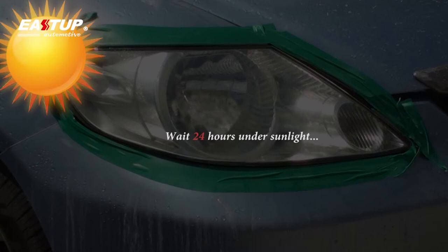If there are UV coating runs or spots, continue with the next steps. In order to achieve a smooth, even lens surface free of drips or runs, let the coating dry for at least 24 hours under sunlight before proceeding. It is still possible to drive your car after drying the coating for one hour, but do not proceed with the next sanding step until a full 24 hours has passed.